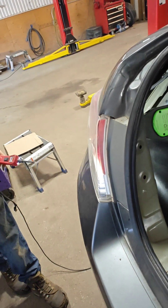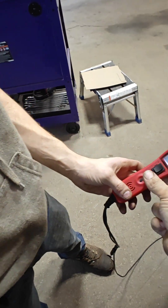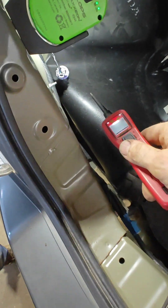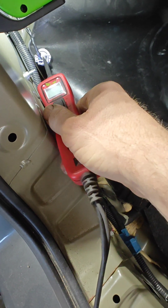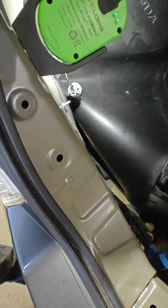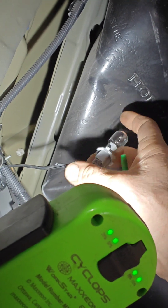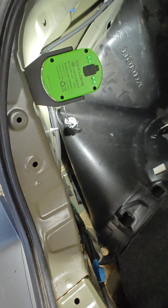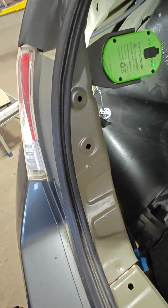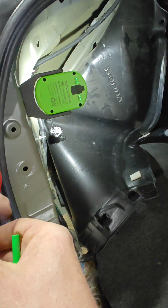We check the blue wire for power — we don't have power here, but it's showing a ground indication on that side as well. This is the beauty of the power probe: that indication tells us the bulb is good, because we can make a complete circuit from the blue side through the bulb to ground. We know the ground circuit is good and the bulb is good, so we're going to feed voltage to that blue wire and see if the reverse lights work.